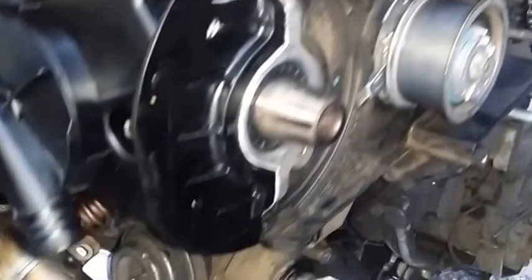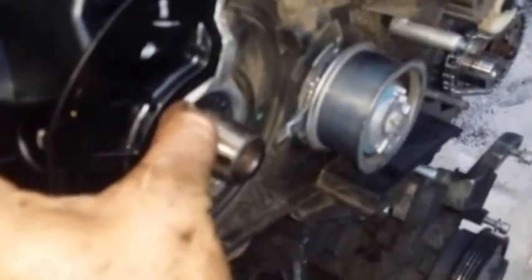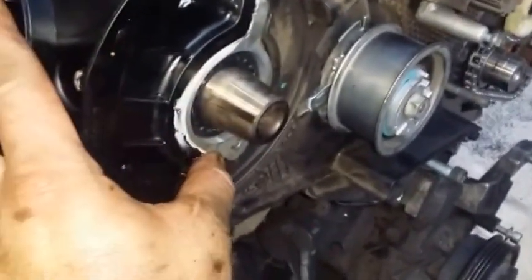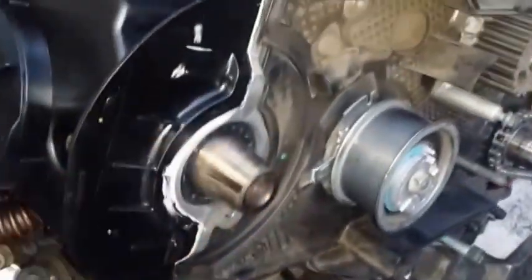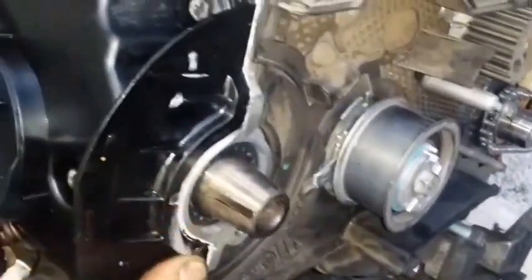I have put the rocker cover back on, sealed it, put the rocker cover gasket, a brand new one, put silicone, a little dab from the inside when you put the seal inside of the grooves all the way around, and then I put a good portion. You see it's sticking out in some areas quite good. I put a pretty good portion from the outside, so when it sits it can squeeze through all the holes, and I tighten it by hand.